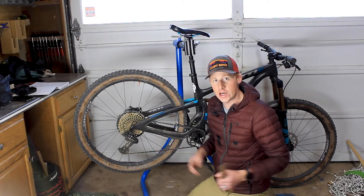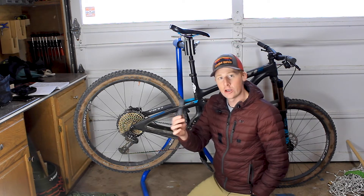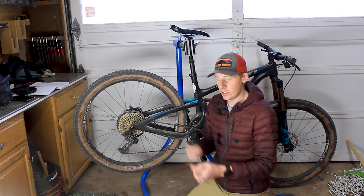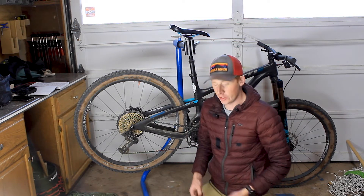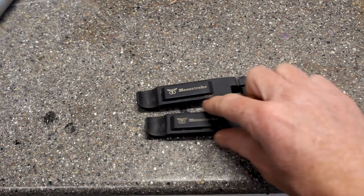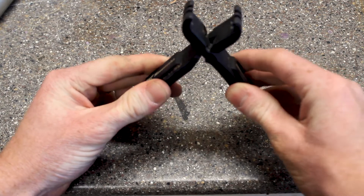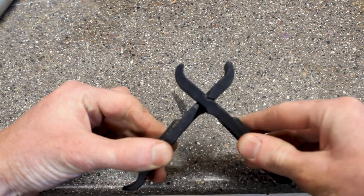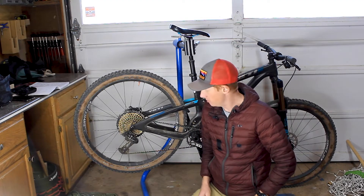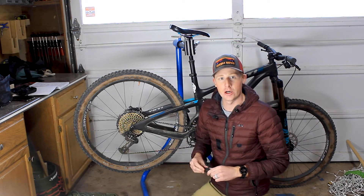In comparison to other tasks on this bike, the chain removal is going to be pretty easy, as well as measuring chain wear. All you need is a set of tools to remove it, such as these Moose Trek tools and a ruler. The tool I really like using for removing Master Links are these Moose Trek tools. The cool thing about these is they not only can take on and off a Master Link, they also double as tire levers. I've taken them on the Colorado Trail. They're really handy to have and very sturdy, pretty hard plastic. I'll put a link in the description to their product on Amazon.